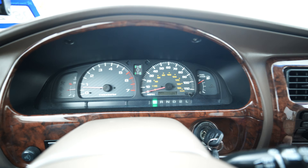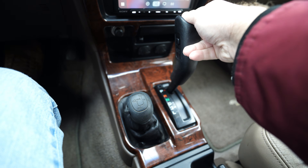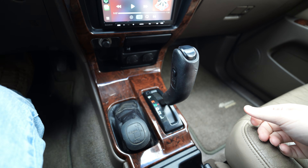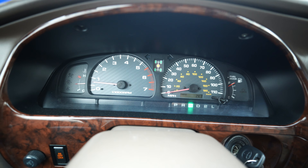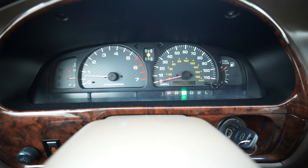Now if I click it again, it should disengage. Put it in drive to disengage — all right, it's disengaged. Now if you want to go to four-wheel drive, you go to neutral and pull down. Now you are in high four locked, meaning that you have locked your center diff. You'll notice now there's a light on that little circle in the center, meaning you are not in all-wheel drive — you are in four-wheel drive, which is four high with a locked center differential.